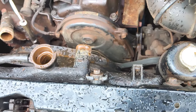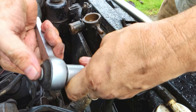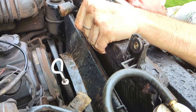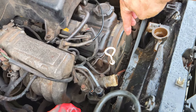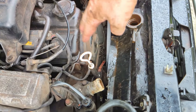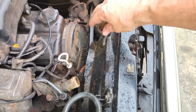Next is going to be these two 10 millimeter bolts here — two of them and I hope that's it, I haven't done this one before. It's the first time I've been able to reach underneath and above at the same time. The radiator's snagging on the transmission cooling lines against the shroud. I discovered the shroud below is actually in good condition — the tabs were just not seated properly in their slots, that's why it was flopping around down below. So I don't need to take this out now. I'm going to put the shroud in properly, like that. So I don't need to pull this radiator out.